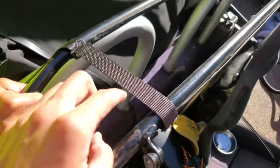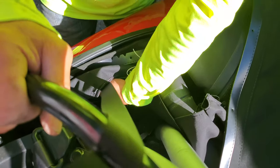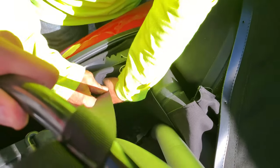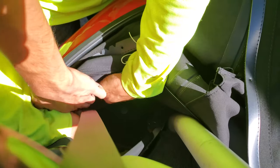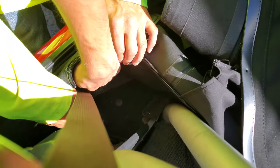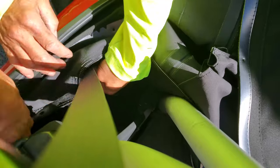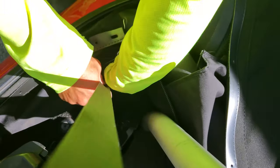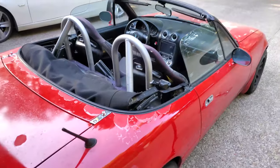With that strap out, routing through the slot in the top and down to the third bolt hole. Now to pull the rest of the top and route the tension cables: the spring end of the tension cable has to be pulled through from this side first, so it can be routed all the way through and down and bolted in down here, right before boxing in this corner. That's the particular order this part should be done in — I'm going to have to undo the other side, get the tension cable pulled through properly, then bring the top back over, fit the tension cables in, and start stretching the top over the front.